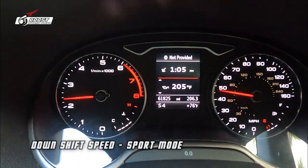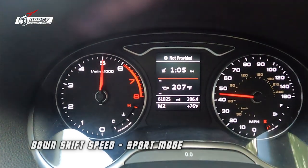Watch these downshifts in sport mode — hit the downshift, hit the downshift. You guys with the A3 know our downshifts were slow. I transferred a lot from the Audi S3 TCU and refined it from there. Changes in this TCU tune: clutch pressure is up to 15 bar — phenomenal — I had to up the amperage to help with clamping force. Torque limiters are raised. Shifting speed is better; in sport mode these shifts are stupid quick.